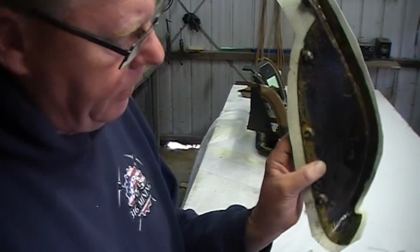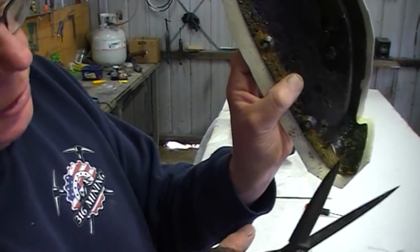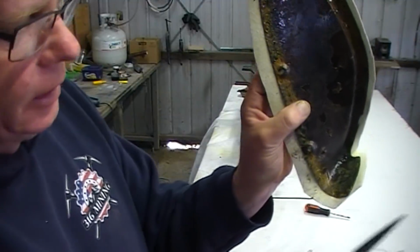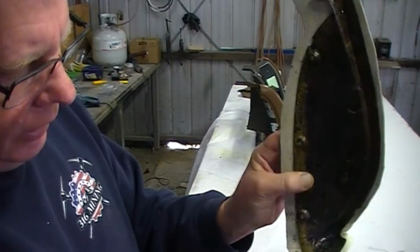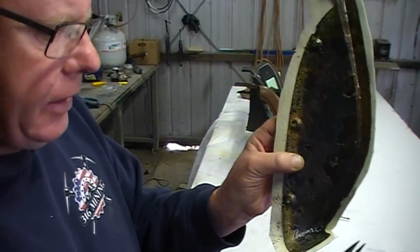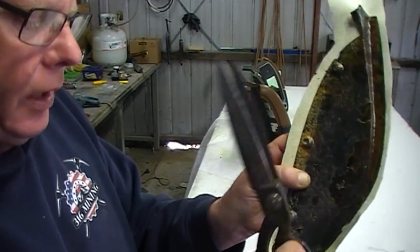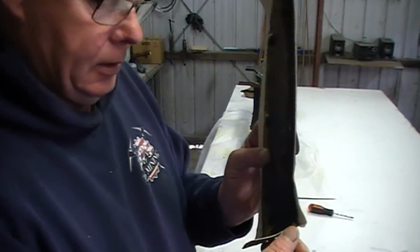Okay, when you want to glue up around a corner, and a corner like that, just put a 45 degree cut across there. Okay, and what'll happen is that little tail piece will bend over the edge, but it'll mean that you don't have any excess of fabric. So that piece is going to fold, that piece is going to fold, and they're going to meet. Much like this. One there, and one there.